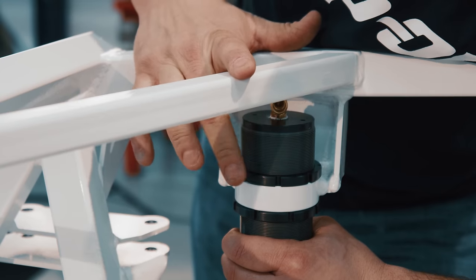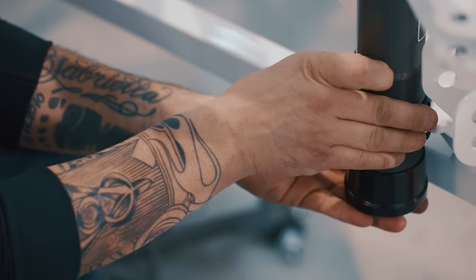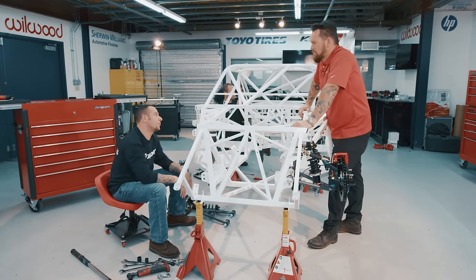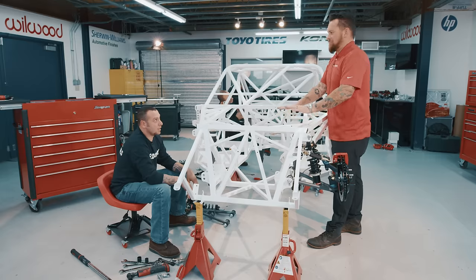It's going to go from here to the track. Normally you put on the corners, but you're putting the air jack in first. These tolerances are super tight between the engine and the suspension, so this has to go in first, then the lower control arm goes in and the bolts go in. He's got four pickup points, so it's super easy to get this thing off the ground for any maintenance or repairs. You put air to the vehicle from one source — it pushes the vehicle off the ground about a foot and a half.